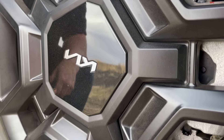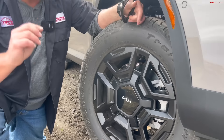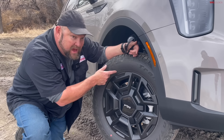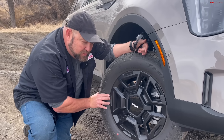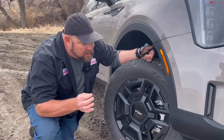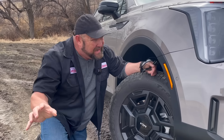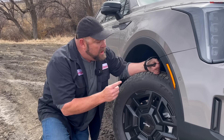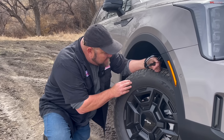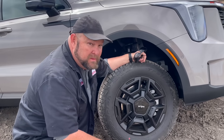They probably can't go any smaller than a 17-inch wheel — if they went smaller it'd probably rub against the brake. The reason I bring that up is because of sidewall. It's 235/65, so you've got a pretty chunky sidewall on a tire that, as far as I'm concerned, is one of the better compromises of off-road tires. The BFGoodrich KO2 is really good off-road but just okay on the road; this Trail Terrain is better on the road, not quite as good as a KO2 off-road. That's where this comes into its own, because I've already tested it on this vehicle — and it works.